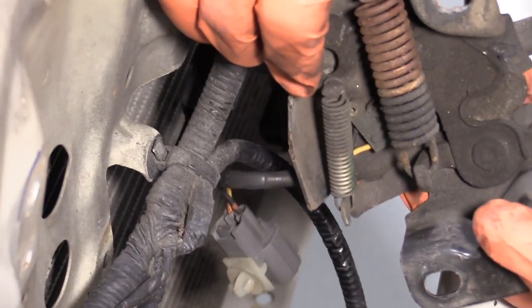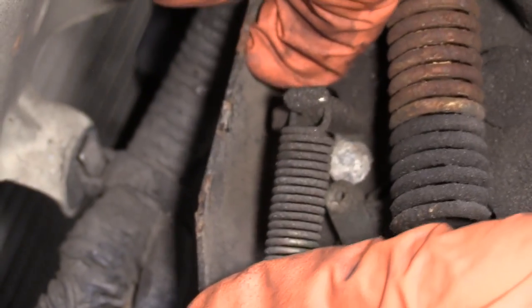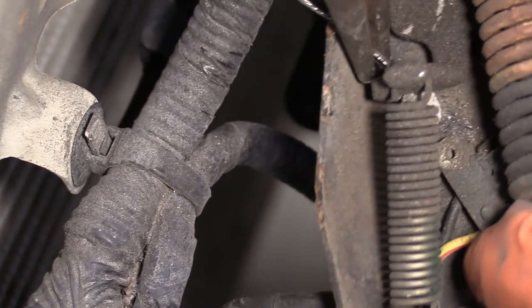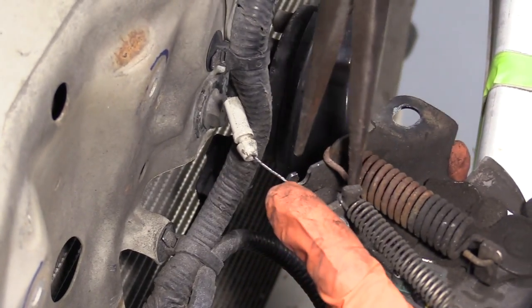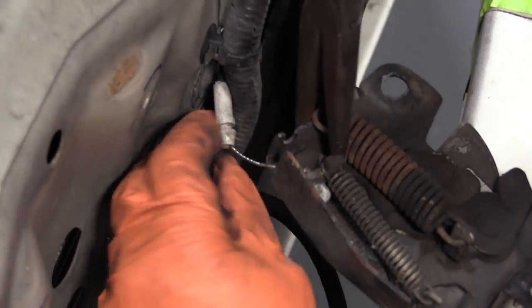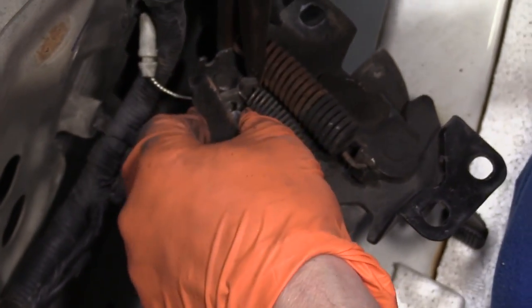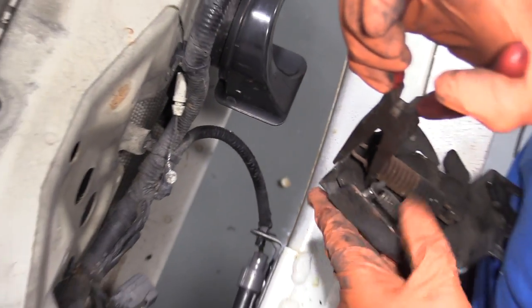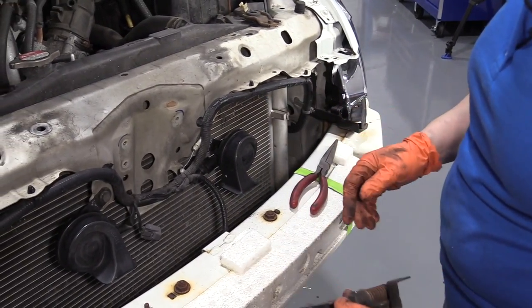See the cable with the ball end on it? See how it has that loop right through there? So we're going to bring that down. You can use a pair of needle nose to get really in there firmly. I'm going to pull the latch so it moves closer to that bracket, take my needle nose and hold it there, and now use my hands to guide that cable down underneath. There we go — that definitely made it easier. So now we have our hood latch dismounted and we can replace it.